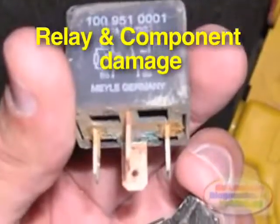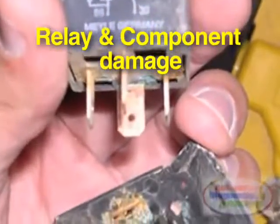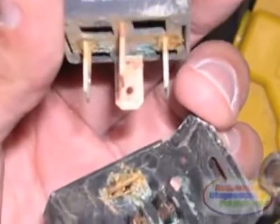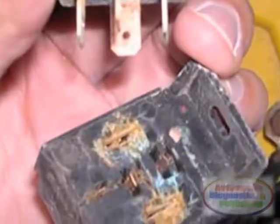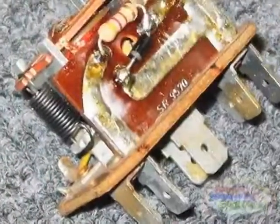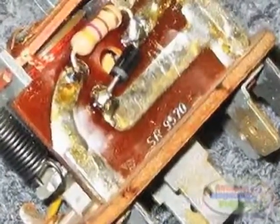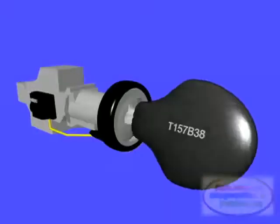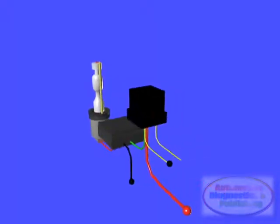The factory design parameters for a halogen headlight circuit are usually 7 amps, and 4.5 amps continuous load. So over time, connectors, multifunction switch, headlight switch, wiring, and fuse holders will slowly degrade because of heat buildup. These components are very time-consuming to replace because they are usually well hidden behind dashboards and other wiring looms. These parts are also very expensive. How can you ensure not to fry the car's internal headlight harness?